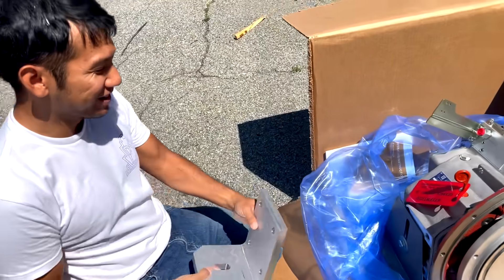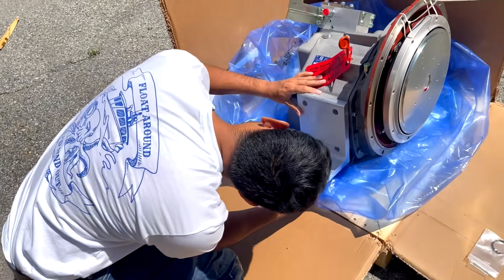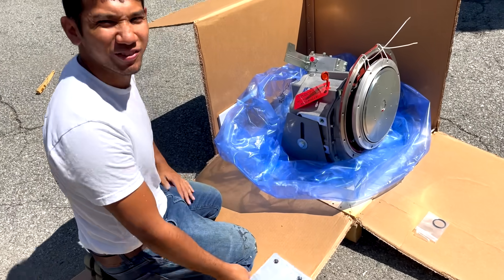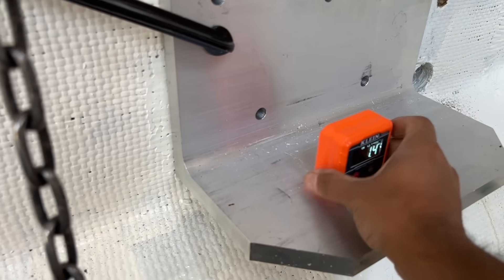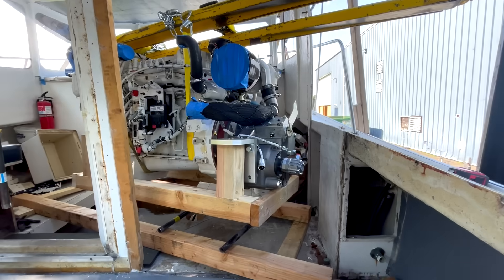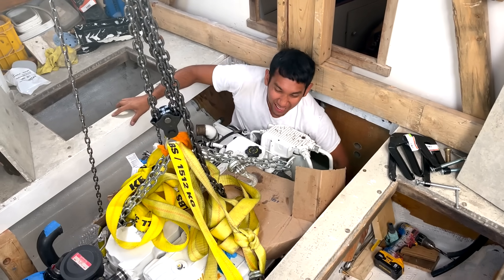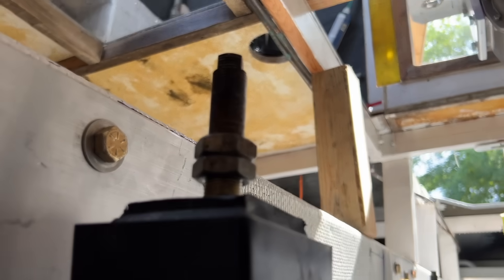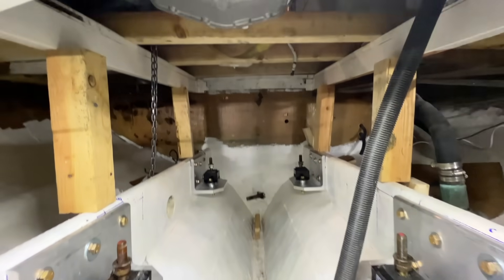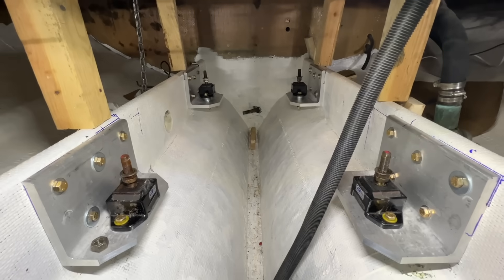Alright Sam, let's see what you've done here. That bit's great — like he's an expert machinist or something. Moving on with my poor life decisions, it's time to put this motor in the boat. We've made some new aluminum brackets, but first we're going to lower the engine down, get a look on things, take some measurements, pull the engine back up, drill the brackets, and install them. These are just some big, overkill pieces of aluminum angle iron that should be definitely suited for this job.